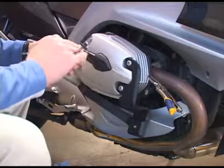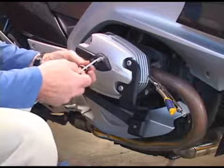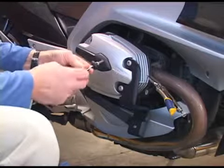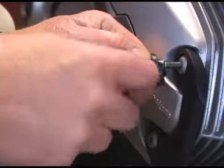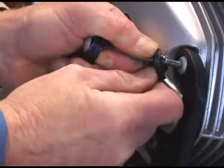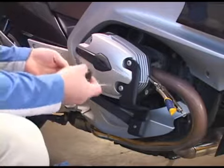The next job is a little more difficult — we need to get that rubber grommet over that shoulder, and this is where a tool like an ice pick comes in handy. Now if you're in the habit of stabbing yourself or cutting yourself, you might want to mount this on a bench vise to work on it. Put the scribe right through the rubber grommet, up over the shoulder of the bolt. Just push on it and walk it right over. Take your time here — you don't want to damage that washer. Some dealerships charge about $8 a piece for these. That's the most difficult job, taking that off.